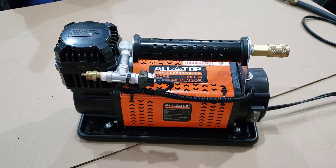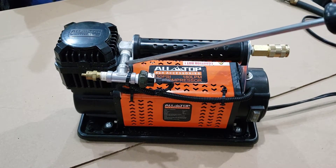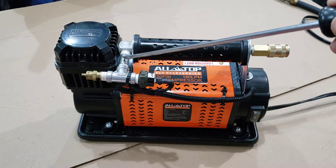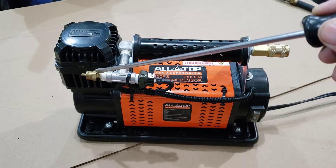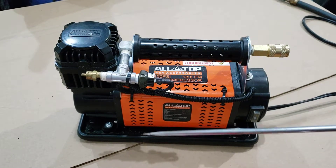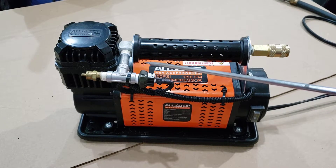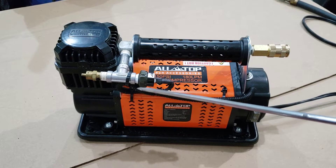There are a couple of modifications. First, this is just a quarter-inch NPT two-inch nipple to a quarter-inch NPT T. This is a 150 PSI pressure relief — I had to remove the original because it popped off at about 120 PSI. This replacement is a pressure switch designed for air compressors, rated off at 140 PSI and on at 110 PSI.